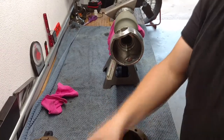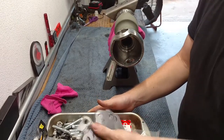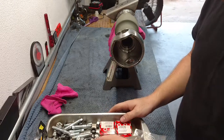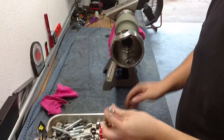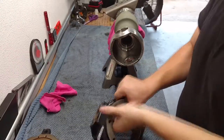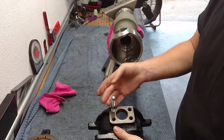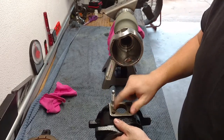I have a tray just out of frame with a ton of Toyota-style shims. Got my trunnion bearings — knuckle bearings, I've heard them called as well. I've got some Trail Gear Super Studs. They have a hex on the top, so whenever you insert them into the top of the knuckles, you don't have to double-nut them. You just put a hex on — I think it's a nine or ten — and tighten them right down, no big deal.